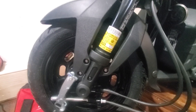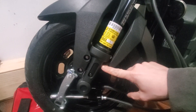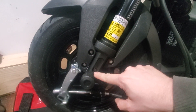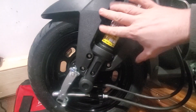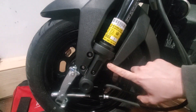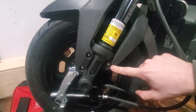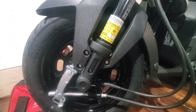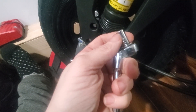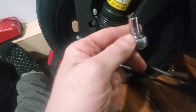To start, for the front you're gonna want to take these off and then the fender off. These caps are held on with one Phillips head screw, and the fender has three eight-millimeter bolts on this side and three eight-millimeter bolts on the other side.